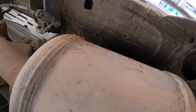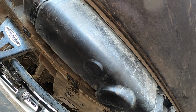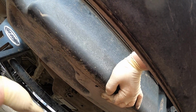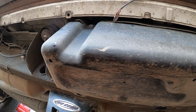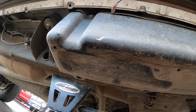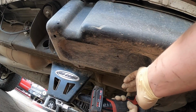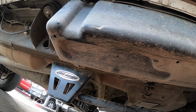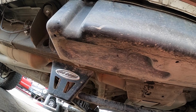Okay. Now I've already got the hose hooked up front. So we need to get my 13. Let me get you guys in a good shot again. Now we're gonna put the shield back in place. So the shield's really easy. It's one of the easiest parts. You just stick it up, and you gotta pop. You see right there, see that lip right there, that clip? Just push it, you'll see it pop through. Perfect. That's all you need. And then now we have three 13s put in. We're done. Now we'll go inside and do the rest of the scanner.